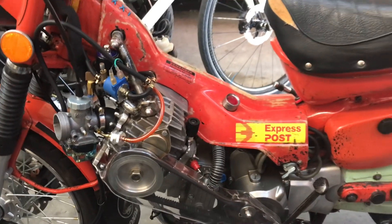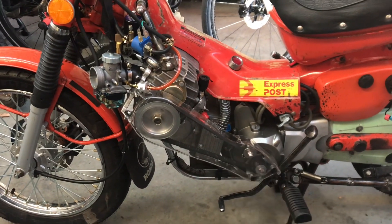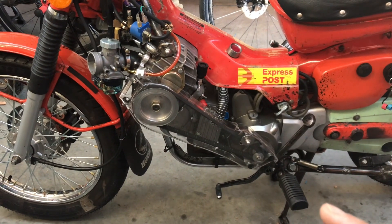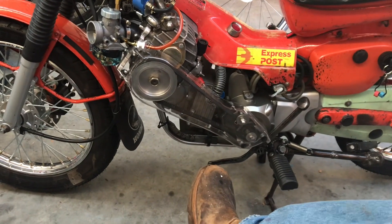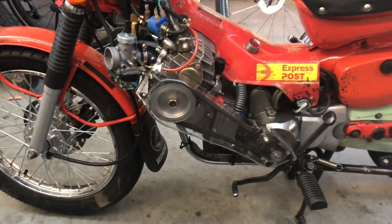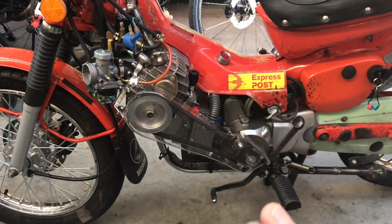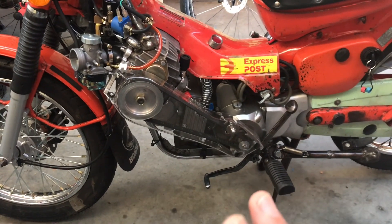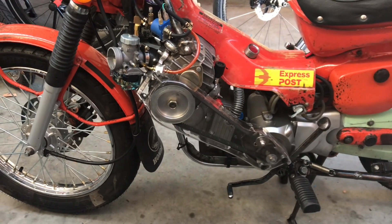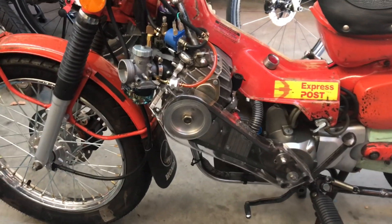I think my fundamental problem is that a blower drags on the motor, and the motor has a semi-automatic clutch so it has to rev low — otherwise when you pop it in gear it wants to launch or it's hard to change gears. So it's designed for lowish revs, but by its very nature low revs means just enough fuel and air to keep ticking over with no load. Well the blower is a load, so the motor needs a few more revs to compensate — it's fighting what I want it to do.